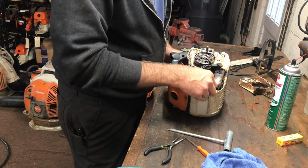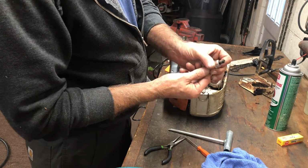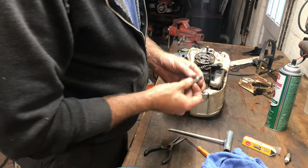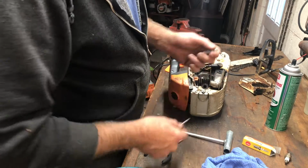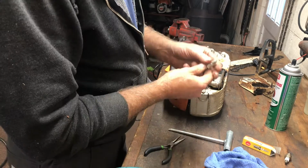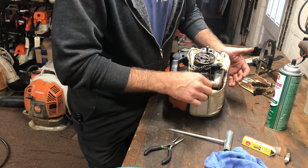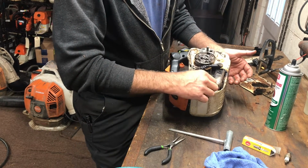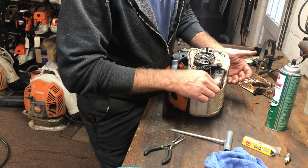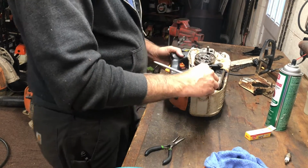I've already looked at the fuel filter on this one. This is good. It has the newer updated orange body. That doesn't look horrible, but they say with the light electrical system that this has, I'm going to re-gap this just a touch. And I mean just ever so slightly. If it creates resistance, it will hinder the operation of the M-Tronic software. These are $4. Twice a year, it ain't gonna hurt you.